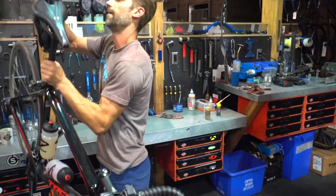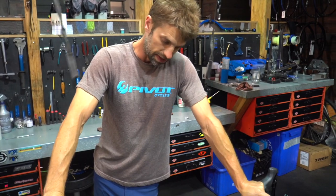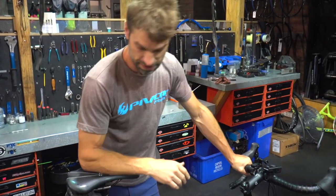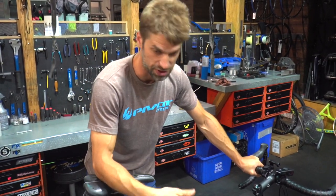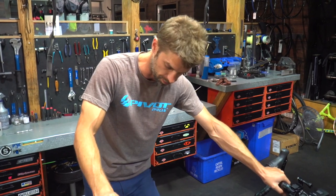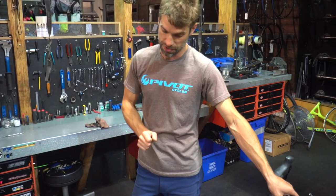After it rains — and it rains a lot in Victoria — one of the key things is to oil that chain up. That's why you do it after your ride, so you've got fresh oil on there once the ride's done. Oil will also displace water, so if you finish a wet ride with lots of water on the bike, oiling it will force that water out of the chain and prevent surface rust from forming. Same process: oil the chain, let it sit for a few minutes, then come and wipe off as much as you can.